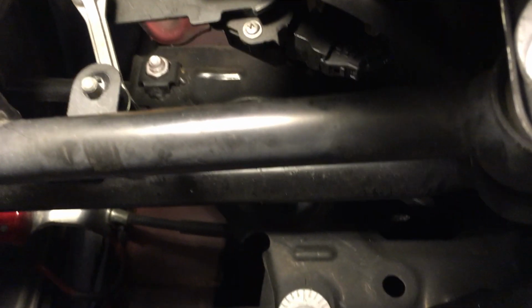So because I got some Ohlins on here, and the Ohlins lower the car a little bit, or at least where the setting where I have it anyways, I have it at about 14 inches from the center of the wheel up to the fender. Stock, if I can remember right, it was 14 3/4 inches. So basically I went down 3/4 of an inch in ride height.